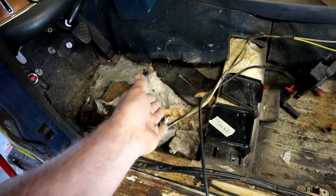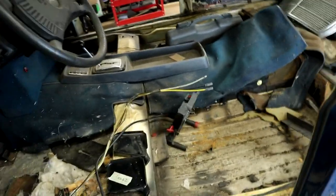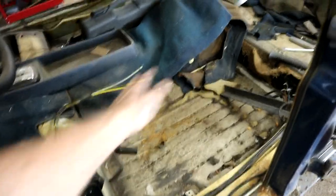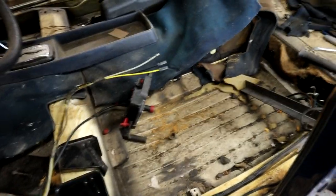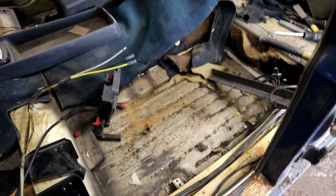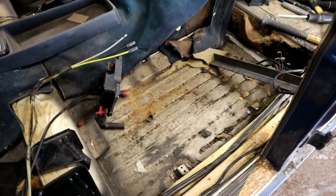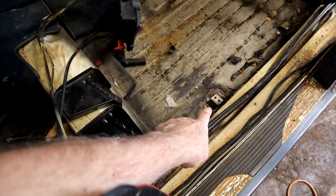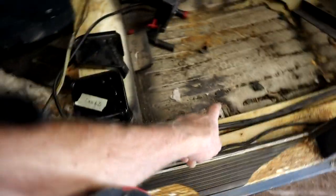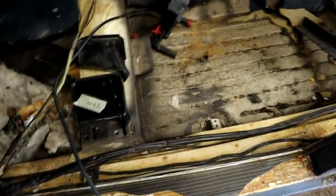I'd love feedback on disconnecting this floor pan — it attaches to the central transmission tunnel too. My thought is to cut most of it out roughly, then dig into the corners to find the connection points, clean up, get it prepped, and spot weld the new one in. Sounds easy but it's a ton of work. Worth doing properly. I'm assuming the seat anchor points don't come with the replacement floor pan, so I'll make up a dummy frame to ensure those locations go back in exactly the right place for the seat runners.